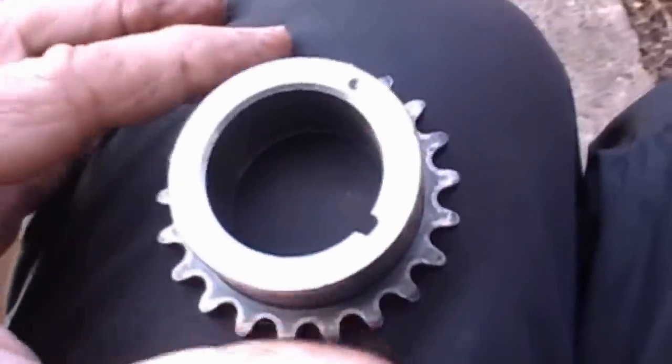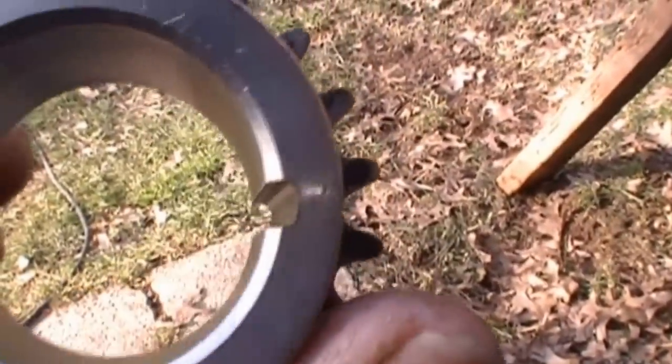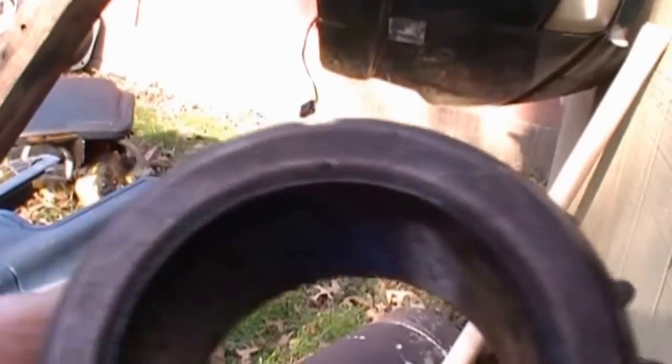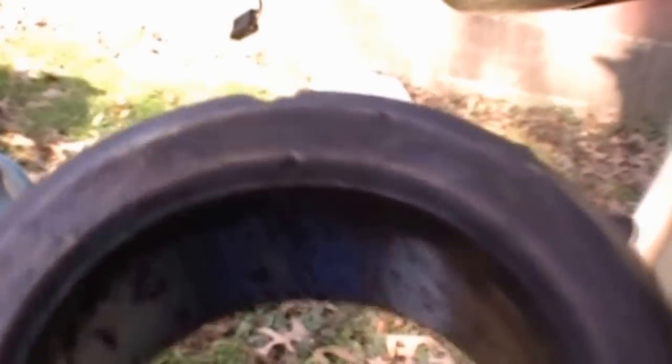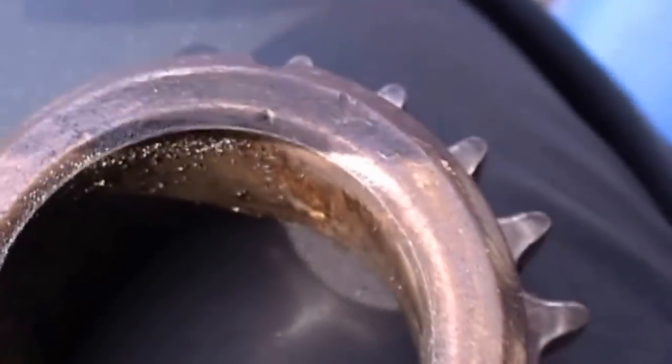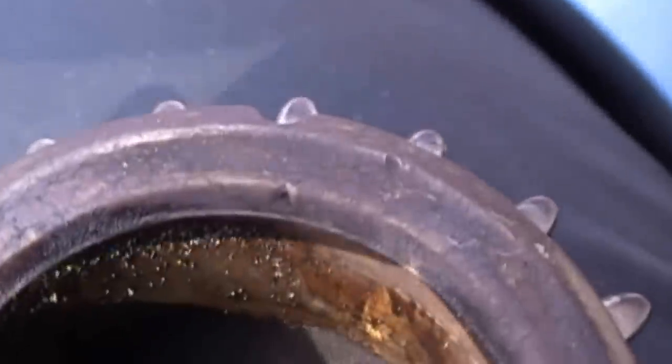I want to show you this - remember I was telling you about the timing marks. Here's the new gear with a mark, and you can see there's a slot cut in the gear for the wrist pin with a little timing mark. Now here's the old gear - there's the slot cut in, and there IS a timing mark, you just have to look really hard to see it. If you count from the slot - one, two, three, four, five, six, seven - the seventh tooth - there's a place cut in right there at the bottom. Maybe they took a punch to it. That tiny little scratch mark is your timing mark on that gear.